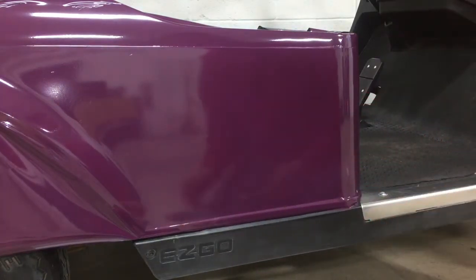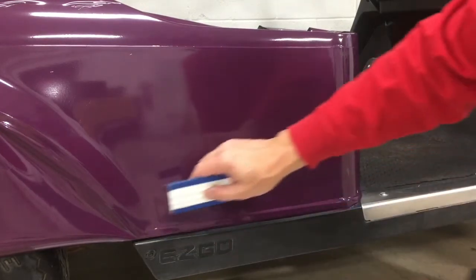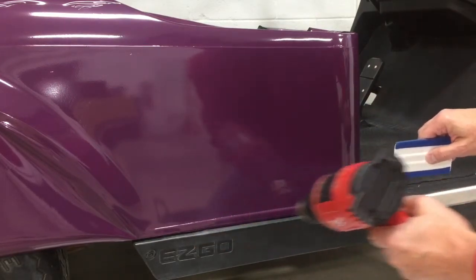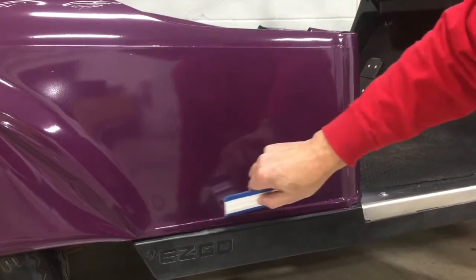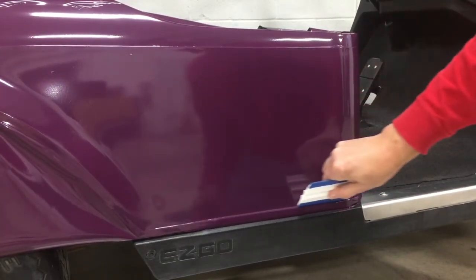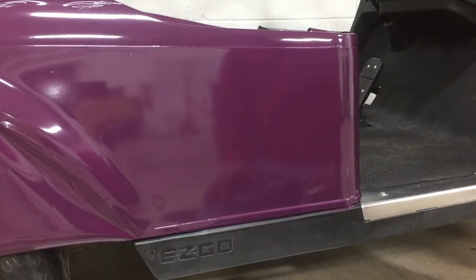In the crease area at the bottom, you can use your heat gun to warm it, run the blade part of your squeegee in there, and tighten the film in. Once everything has been installed, you're going to post heat. Post heating is very important because that's what activates the adhesive to take its permanent bond. Yes, it's on, and chances are you wouldn't have any issues, but post heating is what activates that adhesive to permanently stay in position.